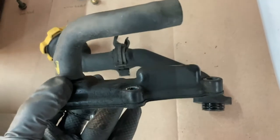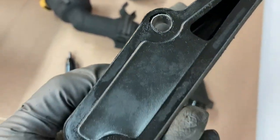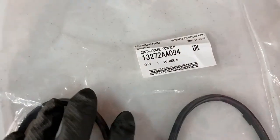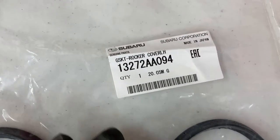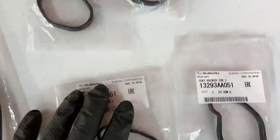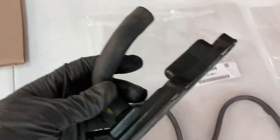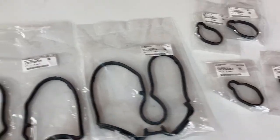Here's what it looks like now that I've taken the plate off — it comes off pretty easily, just three 10 millimeter bolts. I lost my ratcheting 10 millimeter so I just had to use a thinner-walled 10 millimeter to get that left bolt off. There is a gasket under here that I have a replacement for — I'll probably just swap it out. I'll make sure to put links to everything I've used in this video. You can find aftermarket gaskets for all of this, but I just stick with OEM. I have the right and left valve cover gaskets, and the gaskets that go around the spark plugs — two per side. I'll leave links for everything in the description. There is also a master pack you can order that has everything needed to do this job.